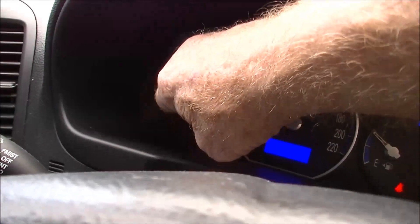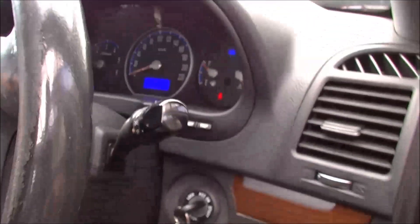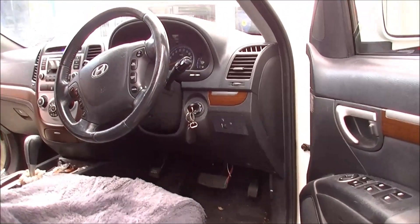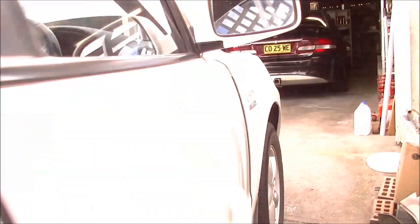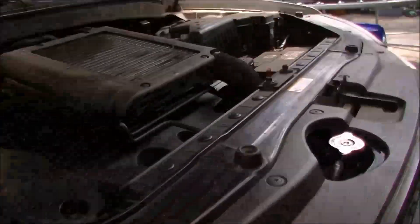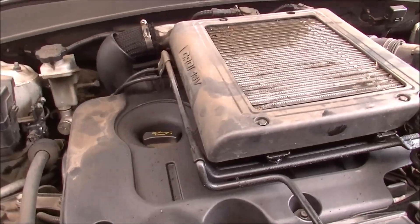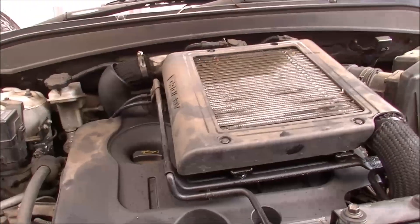You would probably have a check light up. If you don't have a scanner, you can quite easily disconnect the battery, turn on the ignition, put the headlights on, leave it for a minute or two, then turn it all off and whack the battery back on — your light will go away. It'll stay in your history codes though, so you really need a scanner to clear the codes properly. But yeah, we should be sweet as now.